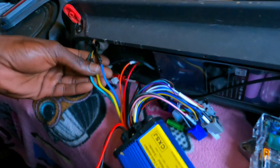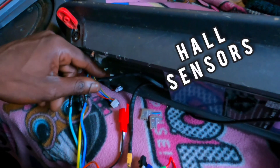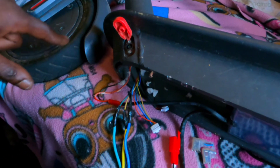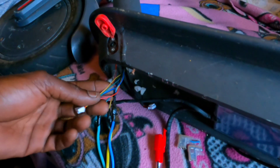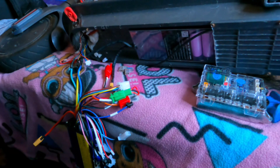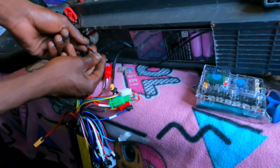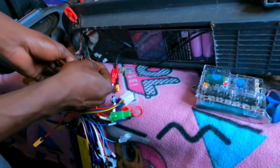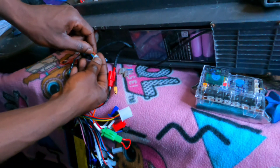The next thing will be the hall sensors. You can tell they're the hall sensors as they go to the same place — the front hub motor on your front wheel, unless you've got a rear wheel drive, which would be cool for wheelies on an e-scooter. Anyway, hall sensor time. Hall sensors can look a bit tricky because of the many wires. From your scooter, e-bike, or whatever you're working on, you should have a bunch of wires next to your phase wires.